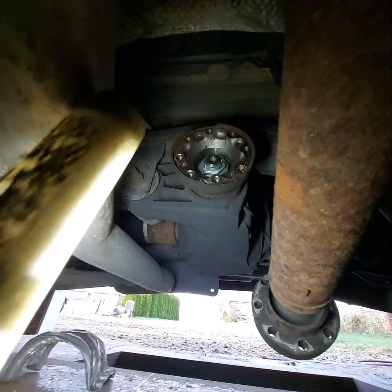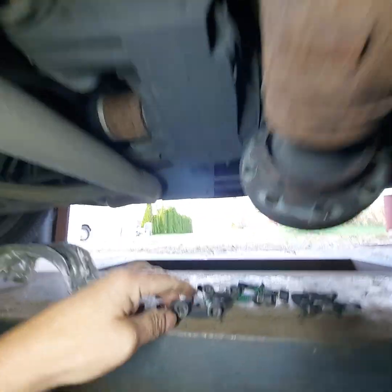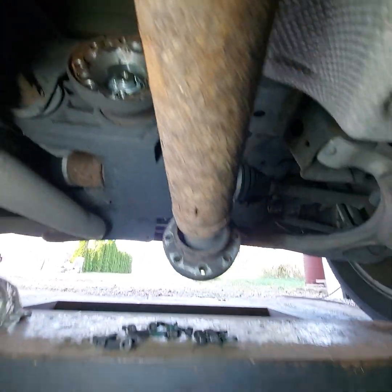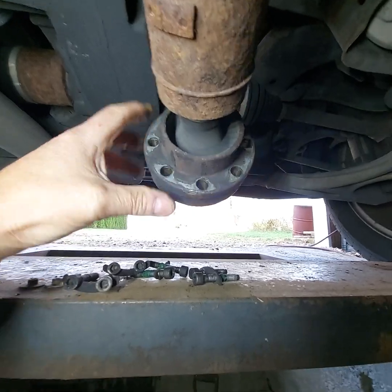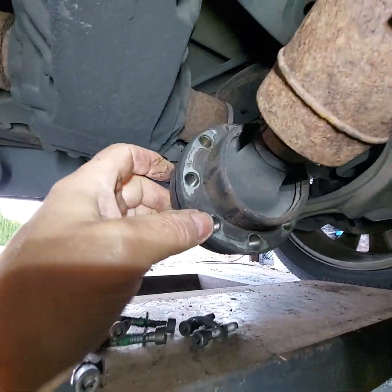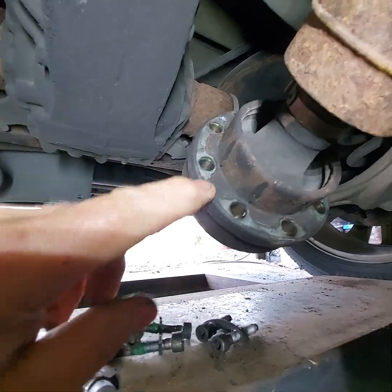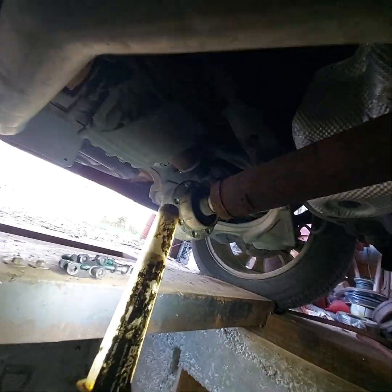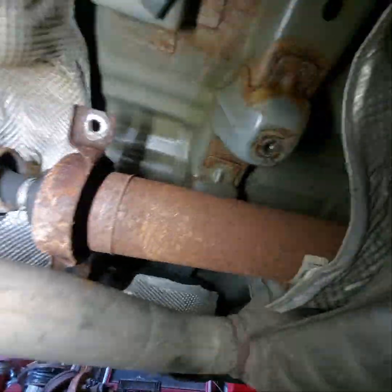the back has 8 bolts, and they're 8mm or 5/16, whatever you want to use. That goes around there, and these are actually like a CV joint. They got little bearings in there. I'll show you here in a minute, but got that out, got it loose, and you got to take the carrier bearing out.